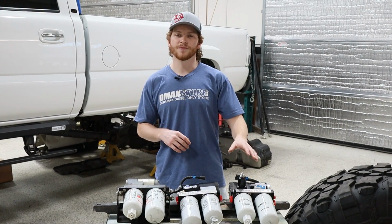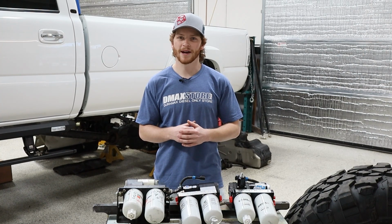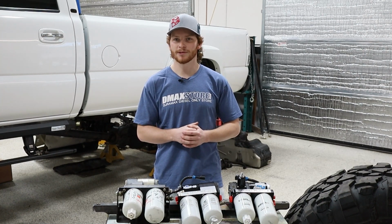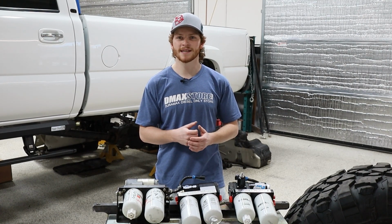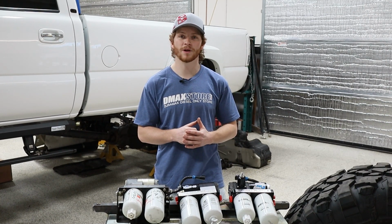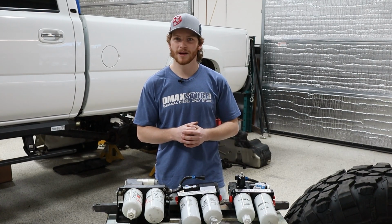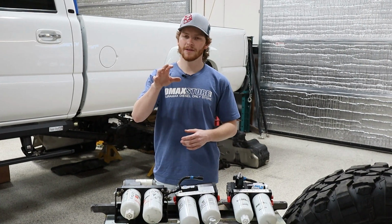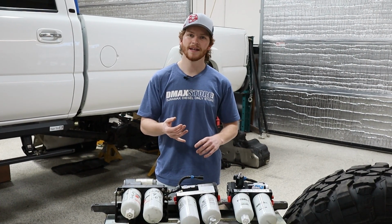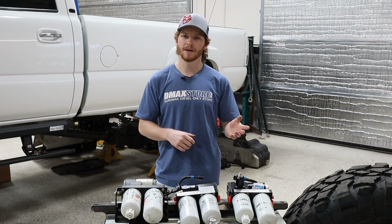These AirDog II-5Gs are going to be set to the correct pressure for your application right out of the box, but we always recommend to double check it. We check them at the test port in the engine bay with the OTC 6754 fuel pressure gauge tool. That's a good way to make sure that you're making the right amount of pressure to the engine bay and there's no restrictions in the system. Be mindful to check around your filter head and your engine bay to make sure there's no leaks within the system and you're going to be making that pressure.